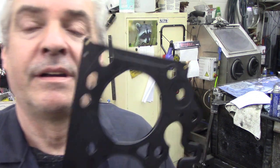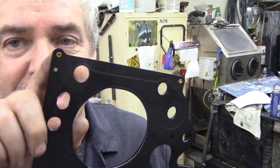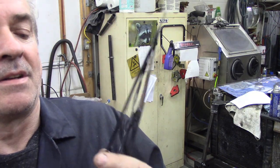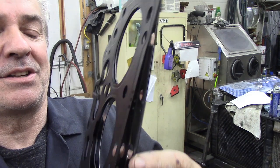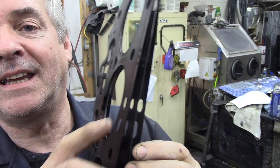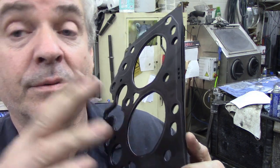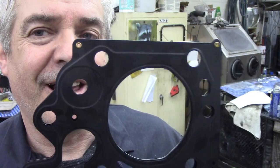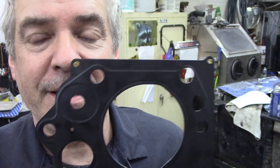It means not putting two gaskets on, but taking the gasket apart, because they're only held on with rivets here in the corners. Taking a shim out — they're made of different thicknesses of shims, that's how they do it. The shims inside are flat, but on the exterior they're pressed so that when you compress the head it makes a seal. I'm thinking: if it just needs that extra little bit of thickness, could we take this apart, put a shim in it, and make it even thicker?